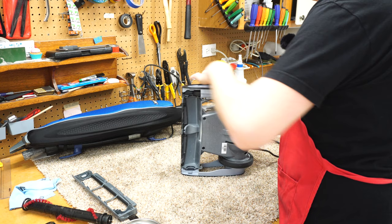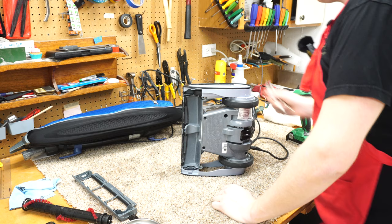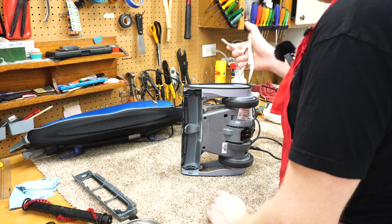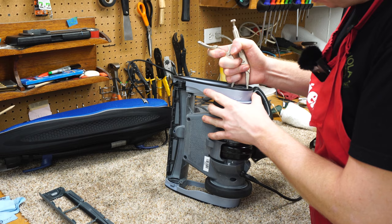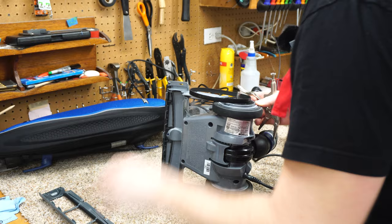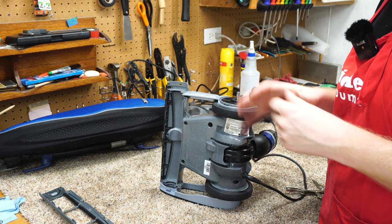This vacuum I use is far more powerful than this thing. Now let's set this aside. This cover is going to come off — Oreck actually put out a tool for doing this, then they stopped making them, so they're kind of hard to get. There's a lock and unlock arrow, so you give it about an eighth of a turn to unlock, and now the cover's off. We can get to the belt. The belt is a long-life belt and should last the life of the cleaner, but sometimes debris does get stuck in it.